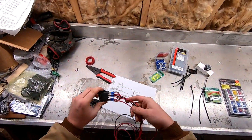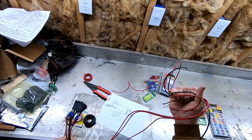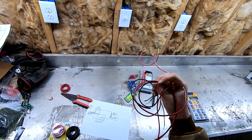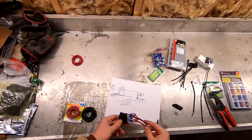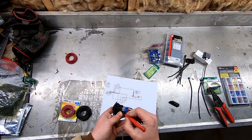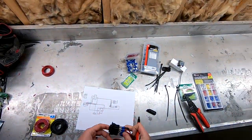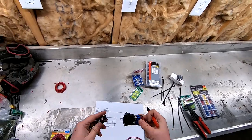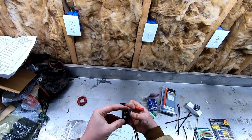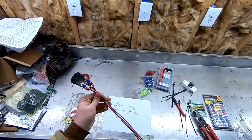This is the general idea of what the switch is going to look like once it is all wired up. The other wires I have left long, I'll strip the ends and leave the connectors off until I'm ready to install. Also, before taking the switch to the Ranger, I'm going to make a small mark to notate the up and down position of the switch — that matters when putting on the actual cap of the switch, making sure it's in the correct direction.